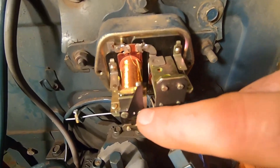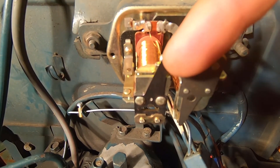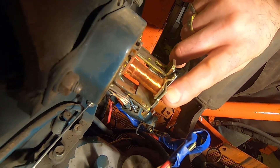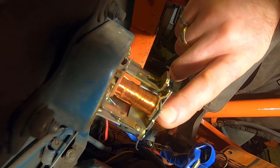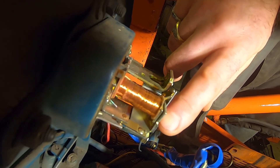You can see here — I'll try to zoom in because this is what was missing in other videos I've seen — there's this very thin piece of metal. I'll try to show you from a couple of different angles. There's this little spring-type effect here, and that is connected to this part, which is the relay. You can see how that will flex. As voltage is applied to this coil, it induces a magnetic field which draws this in, and that's what cuts in or out the field voltage on the alternator.